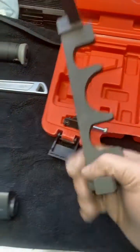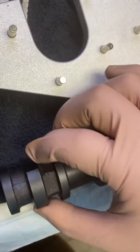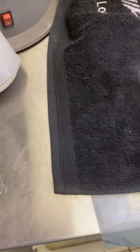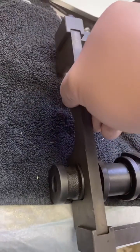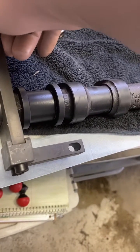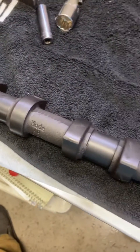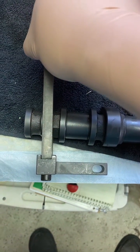The other thing is your bridge lock. This bridge lock goes to the front of the camshaft and it goes on the flat sides right in front of this hex gear. The way that it sits on it — let's move this magnetic sprocket lock — is it sits like so. There's a little bit of movement there; you can see I'm turning it left to right. So when you're locking both of them, make sure they're snug up on both and torque it somewhat before you screw it down with your M6 bolt, so that as you're screwing this down it's torqued sideways and holding it in place nice and tight.